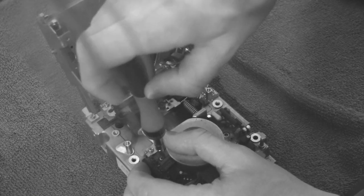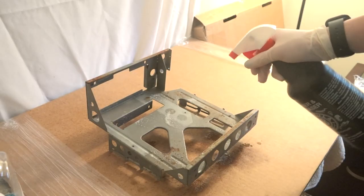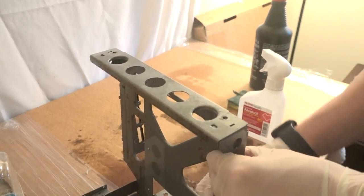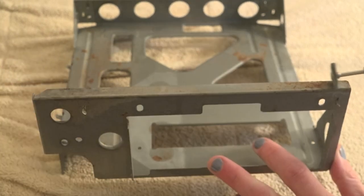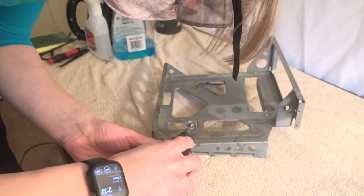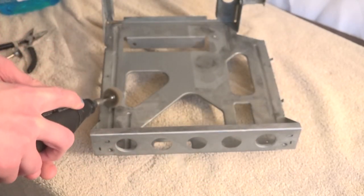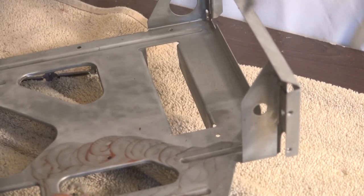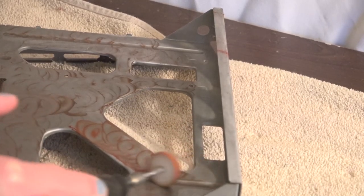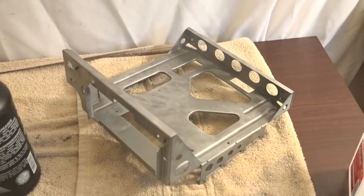As for the drive itself, I'm going to be cleaning that later in the video, but for now I'm going to shift my attention to the computer's metal frame. As you may remember, it is pretty corroded and rusty. So the first thing I'm going to do is give it a good clean in some degreaser to separate the loose bits from the actual corrosion, and then follow that up with some alcohol. Next, I'm going to use a Dremel with a wire brush bit to sort of grind away the corrosion. I will admit that I have next to zero experience using a Dremel for this purpose, but at least I am wearing eye protection as well as a face mask. After hitting as much of the corrosion as I could with the wire brush attachment, I moved on to using abrasive wheels with varying levels of abrasiveness, and then finally I went over the whole frame with a polishing wheel. After removing all of the polishing compound with some degreaser and isopropyl alcohol, you can see all of that corrosion has now been removed.